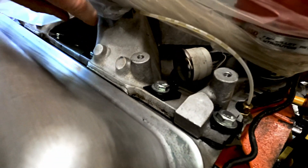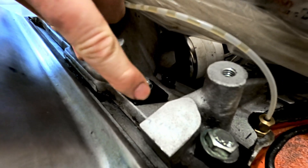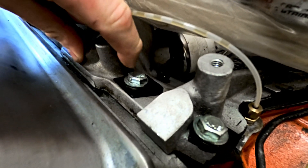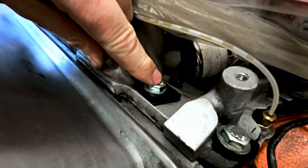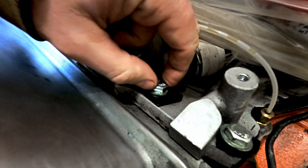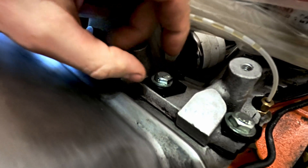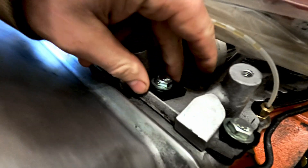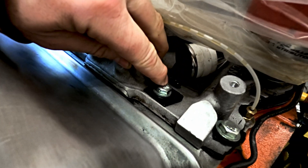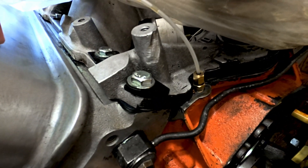So if you look right here on my Gen 2 LT1, these are the shims. You can see it has — I forget the exact angle on this — but it pretty much puts the angle correct for the LT1, just these little shim washers right here. So get a shim, then get a regular washer, put your bolt in there. It has some weird angle, so it's just kind of halfway on there. Has a good clamping area and that's what you want for these guys. You don't want some rigged stuff going on there. This is kind of technically rigged, but it's rigged in a good way that it's not gonna mess up.